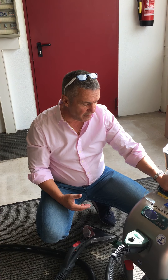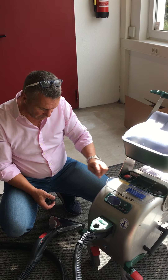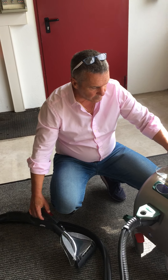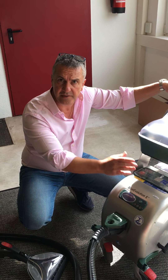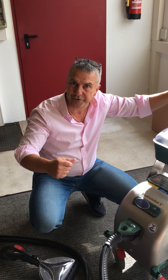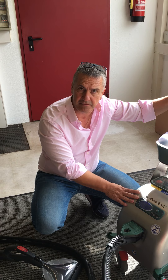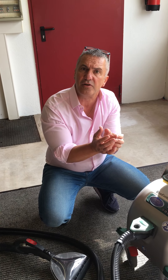Sometimes you need a little bit more wetness — then we have the hot water extraction, which I showed you with the Limatic. The bottle here is a separate tank, also two liters, and you adjust it; you add it directly on the handle. It needs around about five minutes — in your case ten minutes — to heat up for the first time. Later, when you have a break for a coffee, you can continue to work when you come back half an hour later; it doesn't matter because the boiler is very well insulated.